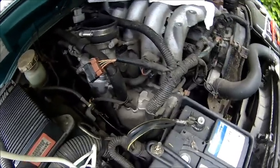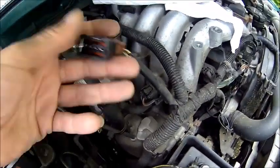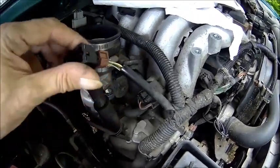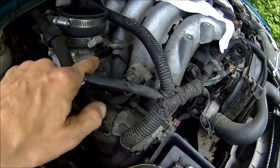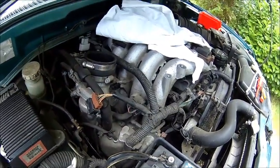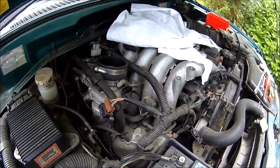I wonder why it's only got four wires - maybe it's got a common. To get it out you need to pull this spring out here - it's held down here - and then you push it down and pull it back to get over these little lugs. But for me it looks good. So what we're gonna do - we check it with a meter if there's any drops. That's it - we can't do much more except changing it.